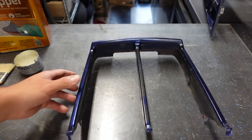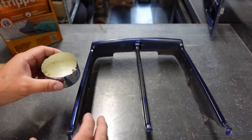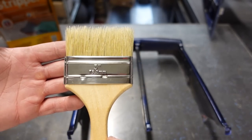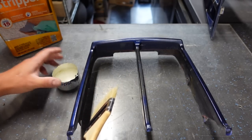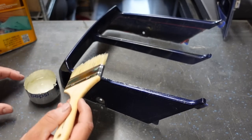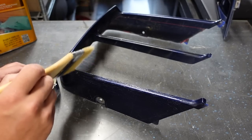Check it out — it's actually a pretty good paint job. To strip it, you could sand it but that would take forever. Instead we're going to use this aircraft grade stripper — you can pick it up at Walmart or any hardware store. Be really careful because if you get it on your skin it will burn pretty bad. I like to use a disposable brush. Just paint it onto your surfaces and let the chemicals do the work — the paint crinkles up and you can wipe it away or blast it with a hose. I do a pretty thick coat; the thicker you go, the more likely it is to get the job done.